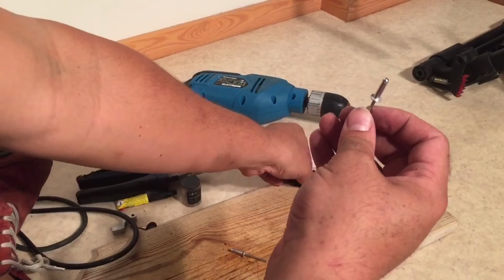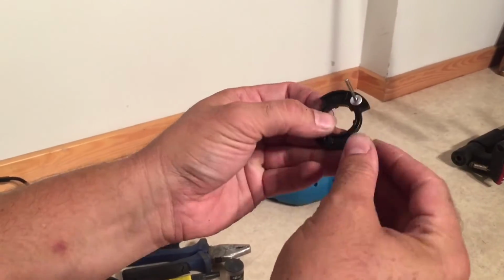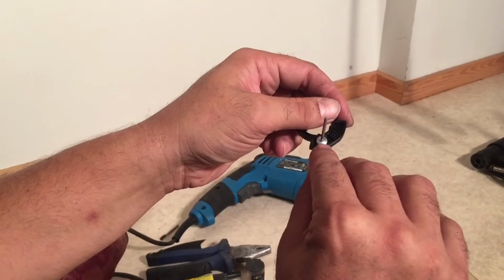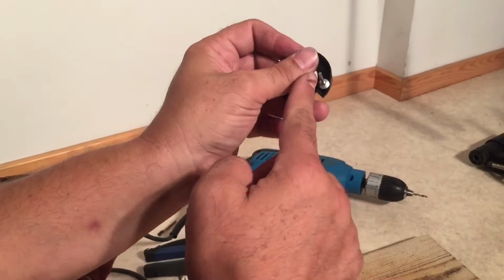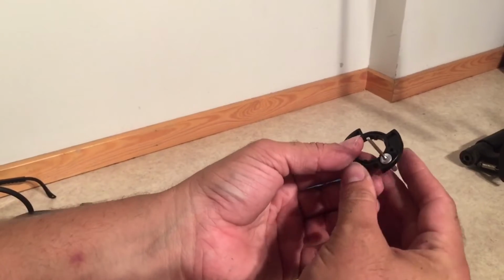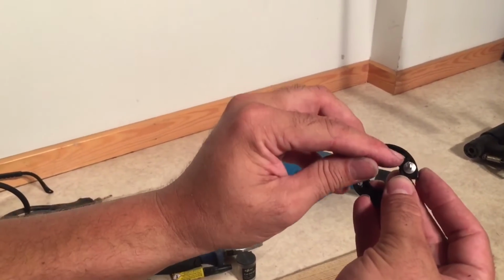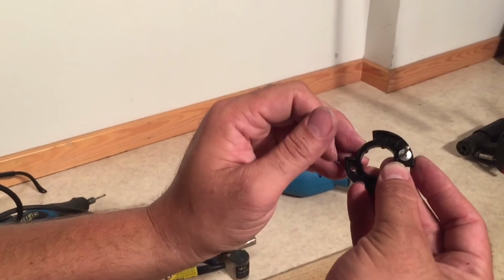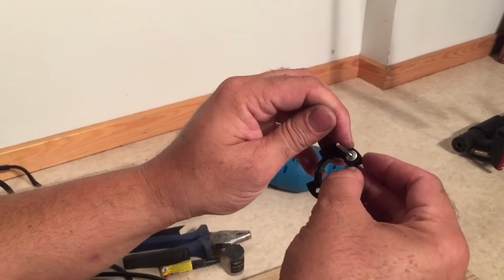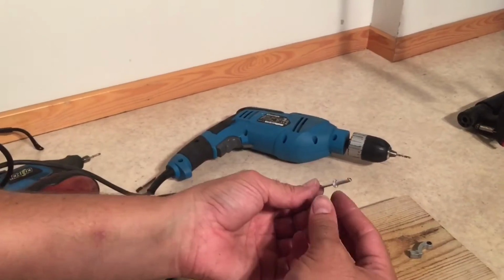So now the deal with this lip, if you look at the inside of your disc, this lip on my rivet is going to go a bit over the sides. So on one side I'm going to have to cut it flat, cut it down on that side and that side of the lip, while on the other I have to cut on 3 sides, because the third side connects with this little bump and hole which connects to the wire inside the central locking mechanism. So one of these rivets is going to be flattened on 2 sides, and one is going to be flattened on 3 sides.